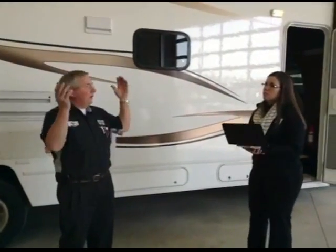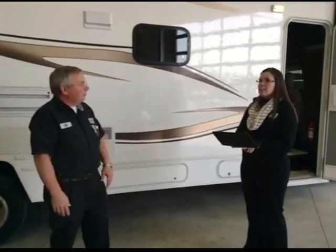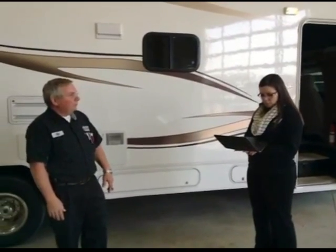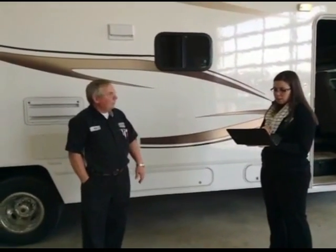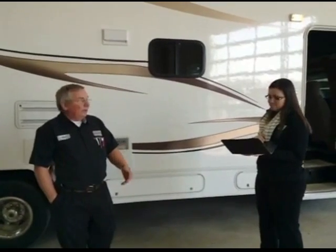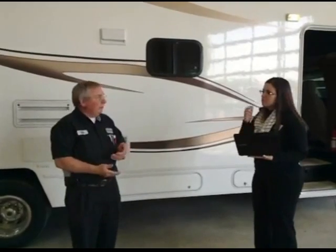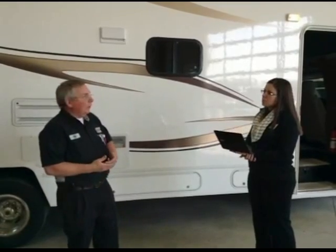And at that point, what a lot of people will do, because it's at the beginning of the year, it's all flushed out, now they'll add about a quarter tank of water to their water tank, and they'll put a cup or so of bleach in there. And after that's gone through, you open up your lines until you can smell bleach out of each one of your lines, and then let it set overnight, and then let it all drain out, run fresh water through. And so that's kind of a good way to sanitize your tank then? Right, that sanitizes the fresh water.